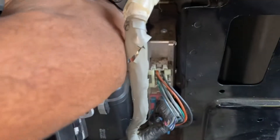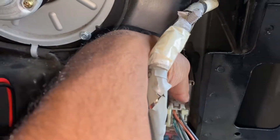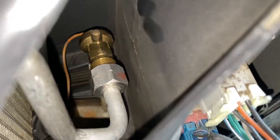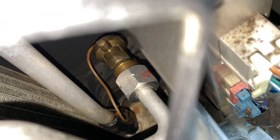I don't know if it's because I spliced the resistor — maybe it's not getting what it needs from in here. I don't really know, so I've got to research that and see what happens. Until then, I may just set the blend door to cold and see if that works. If not, I'm going to have to empty this whole system and check to see if there's metal inside of that expansion valve. But it's troubleshooting — that's where I'm at right now.